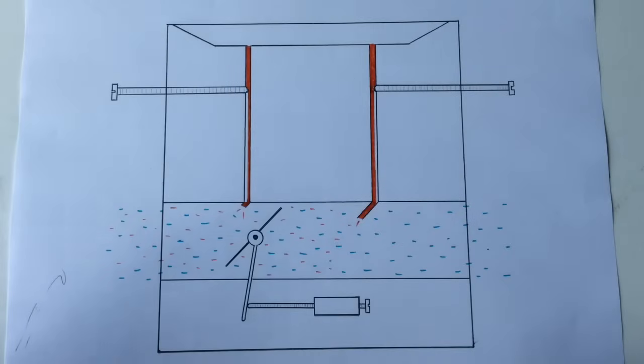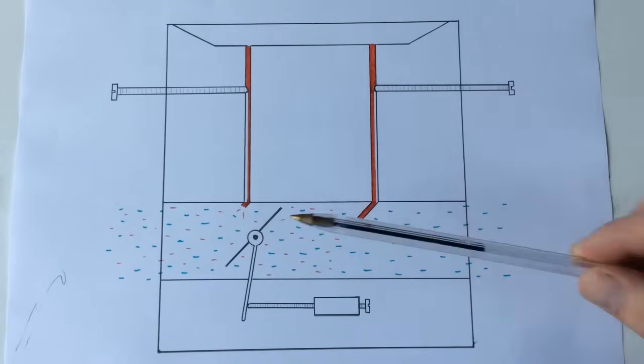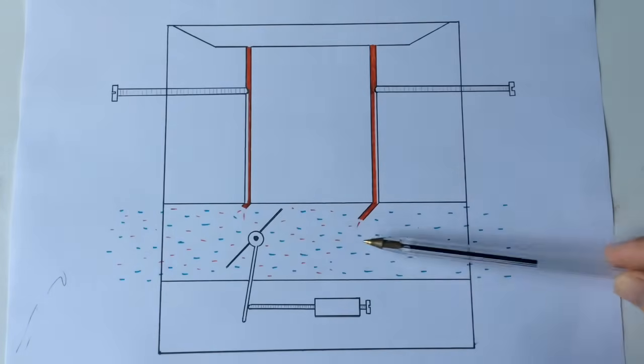So we can see here it's getting a little richer now and it'll have a different tone to the engine. We've got to decipher whether that tone's right or wrong. But at this point I can see it's bordering on towards getting quite rich.